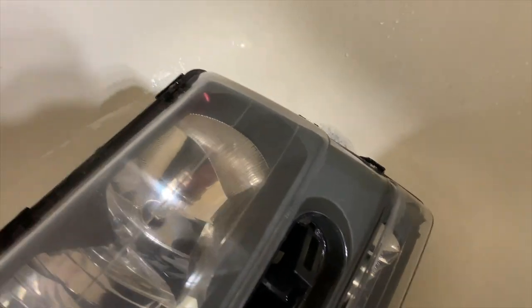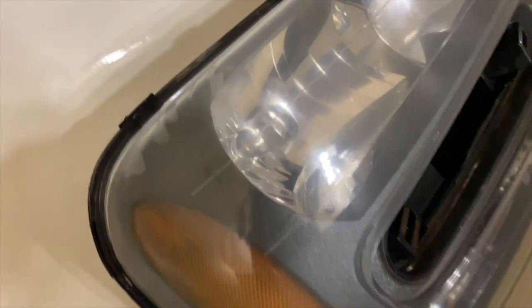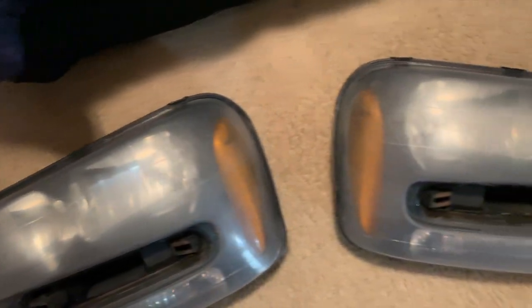That was the third step. I already rinsed these things off and that's the results we have so far after wet sanding. You can already see it's a tremendous difference compared to what these things looked like. Excuse the fact that I'm in the bathroom doing this, but I wanted to get these done in the bathtub just so it's easier to clean up — because these things can sling some dirt. That's literally the oxidation slinging off as I was sanding. Now it's time to tackle the other side, then get these things dried off. All the oxidation is gone. Now it's time for a quick alcohol wipe down and then to the polishing step.